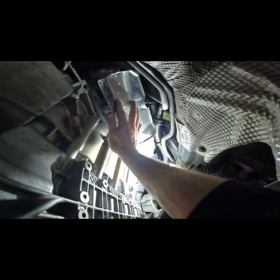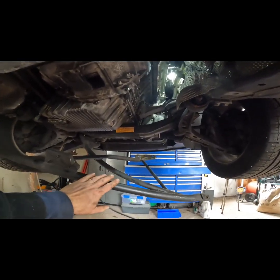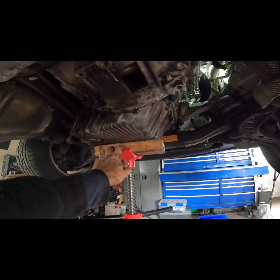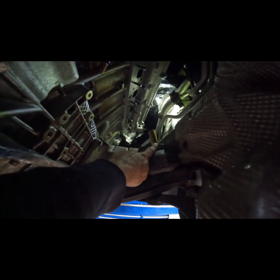Now that I have all the studs configured right, I can put my heat shield, which is also the manifold gaskets. To get these cats in, you can't do them from the top. On a Z3 at least, you have to loosen the reinforcement plate — I just got one bolt over there so that's just going to let that hang, and then it opens up under here. It's actually too tight to get that front cat in there, so I'm going to use my pole jack, support my engine at the oil pan with a block of wood, and take the motor mount bracket out. The engine should not move at all because I have it supported, so I need to take these 13s, these four, and the 16 nut right here to get the motor mount bracket out of my way. That's going to give me a straight shot in.